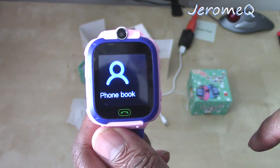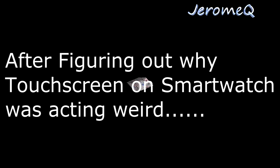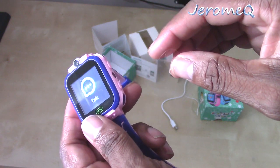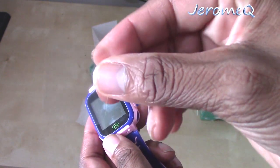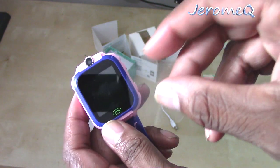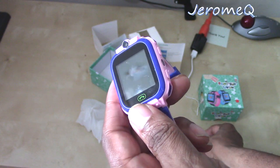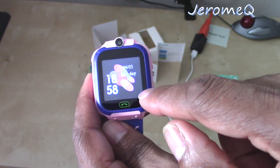Let me get back to you folks about why I was having some touchscreen problems. So apparently, remember earlier I took the first film off the face here? What I didn't know is that it had a second film on here — a little plastic sheet. That was interfering with the touchscreen capabilities of this smartwatch. So I took that off. What you see here is a little piece of plastic. And you notice the screen is really, really shiny now. I'm pretty sure it improved our touchscreen.